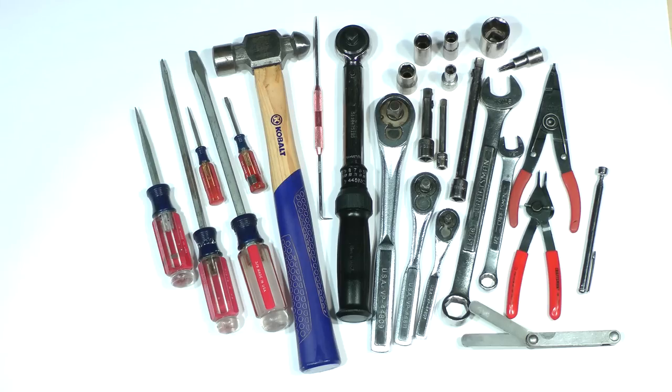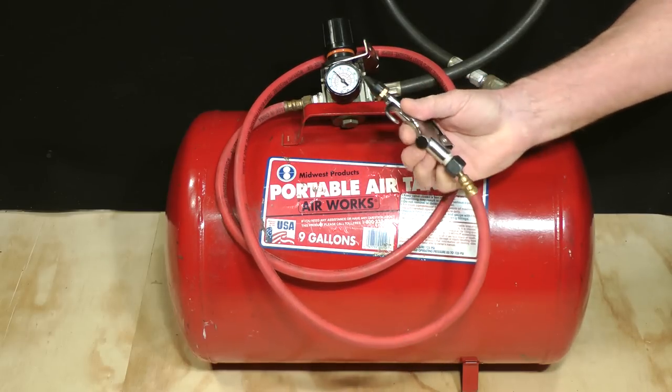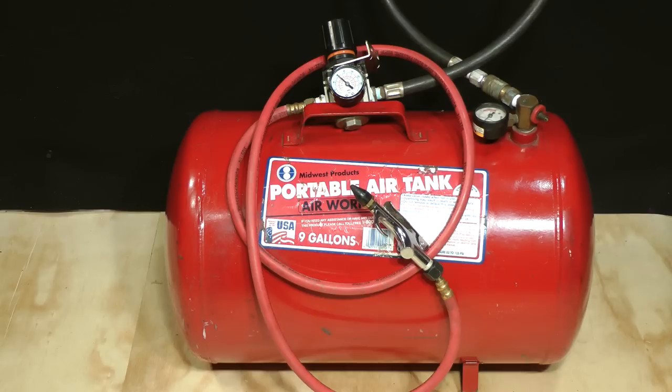A magnetic pickup tool will come in handy. The most exotic hand tool required is an inch-pounds torque wrench. We will not be using any power tools such as air ratchets or impact guns. A source of compressed air is needed to blow dry parts and to perform pressure tests on clutch packs. If access to an air compressor is beyond your means, a simple air tank, adjustable regulator, along with a rubber-tip blowgun like this setup will do the job.